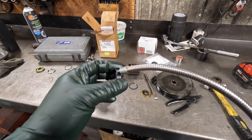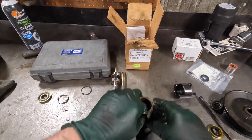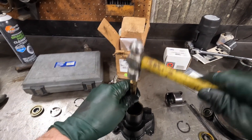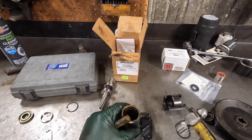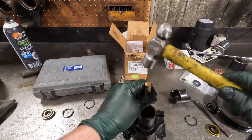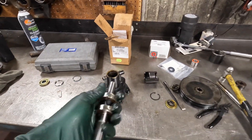Give a little bit of lubrication — we don't put anything in dry. Set it down in here with your fingers. Then use the old dry shaft as a driver and tap it in on the outside. Walk around it evenly — you don't want to damage it, it's rubber — and make sure it's nice and square. It looks good. Next step: let's put our impeller dry shaft kit shaft with bearings in.